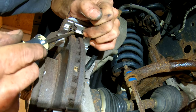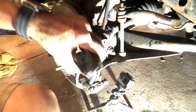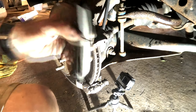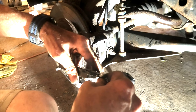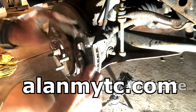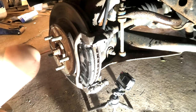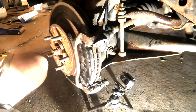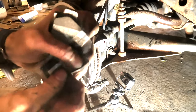It's been a battle with the light but there you go. Now we're going to take and put our little dab of grease at the top of our brake pads, just as we did on the other side. If you have any questions while watching the video, feel free to contact me in the comments below — or I'll put a link to my website in the description where you can use the contact form. We've slid our outboard pad back on. We're going to put our grease on the inboard pad and get ready to install it.